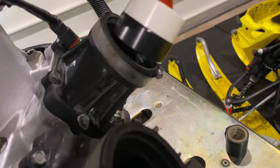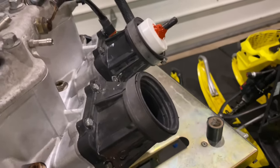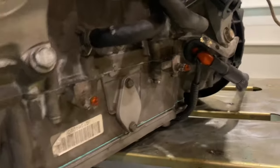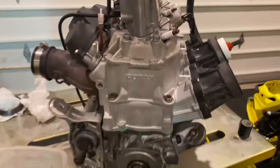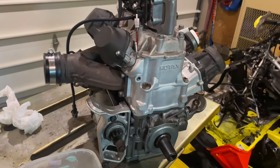As you can see here, I'm going to need a lot of tape for this one — no problem, because I have a lot of vinyl tape. I've got my fuel injectors all installed and all torqued down. The only other thing we're going to have to plug off here are these two oil outlets, and I might have to do my coolant line up here, but I'm going to get to work on that, and then we're going to leak this down. I've got my fingers crossed that it doesn't leak.